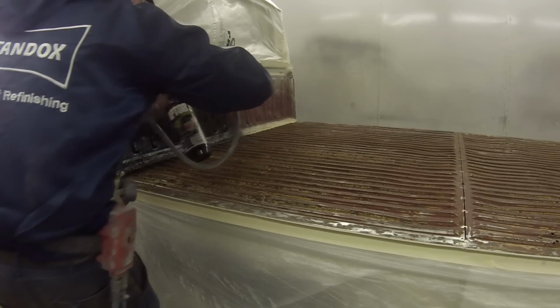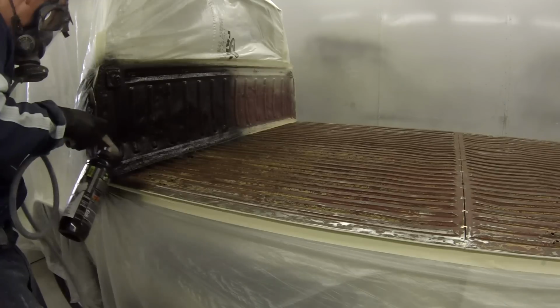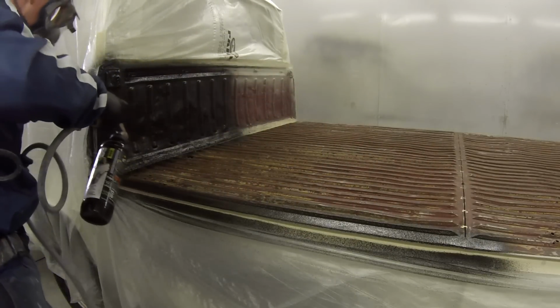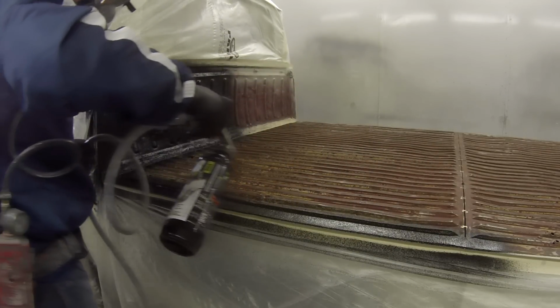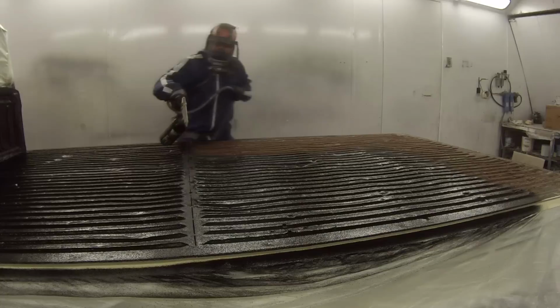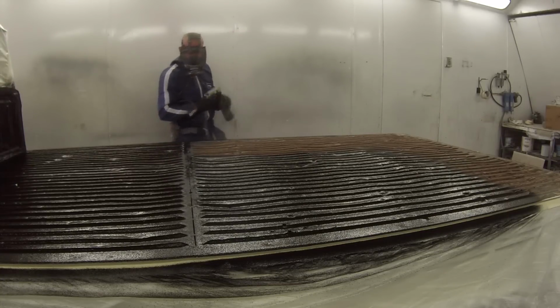It's just steel, so you're going to get adhesion to steel, and it actually says on the can that it's also got some rust inhibitors in there as well. So we didn't get too overly fussed with doing the rust converter on here, being that this stuff said it had some rust inhibitor in it. Going over any aluminium, I would recommend using some sort of an epoxy primer first.